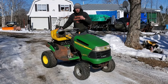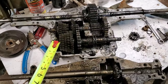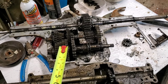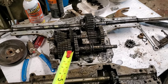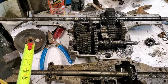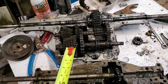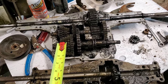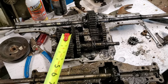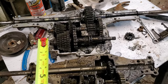The reason that didn't work — I'll include a clip about what I found when I popped open that transmission. When I built the ice racing John Deere, the idea was to be fast — about 25 miles per hour. I ended up doing a 10-inch drive pulley and left the rear pulley as the stock size, which was a little bigger. For most transmission setups that I've built over the years, it should have done a little past 20 miles per hour. A two-to-one gear ratio on most transaxles will usually get you around 21 to 25 depending on tire size.